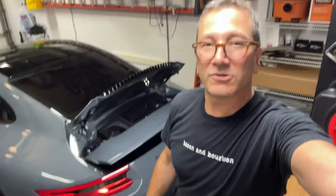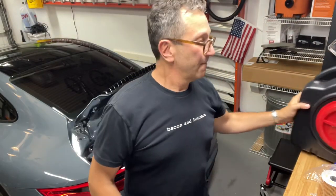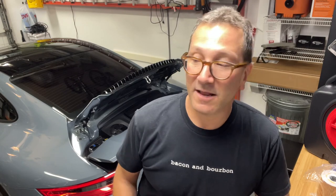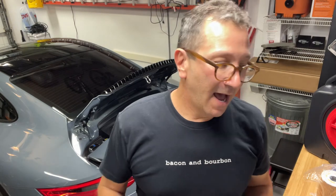And I also have the race ramps. The car's already jacked up onto those race ramps, so I will be using that to give me a little extra clearance, because this wouldn't get underneath the oil drain plug without lifting it up a little bit. I do have a jack, but I thought it would just be a little easier to do it this way. I also realized that by elevating the rear end, it may drain out more oil than what would normally be drained out if the car was level. I'm not concerned about that. I figure it really can't hurt.